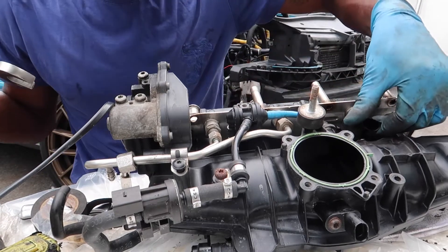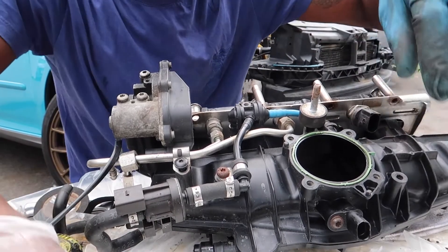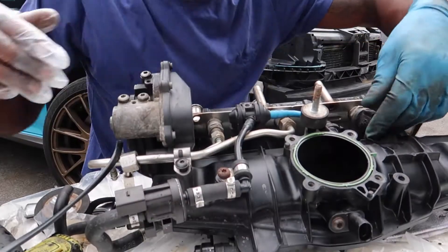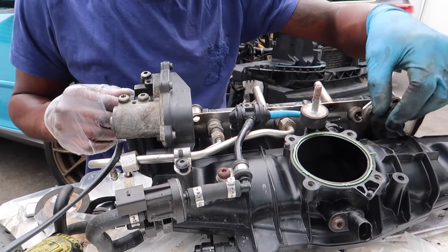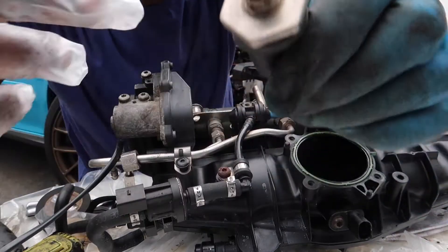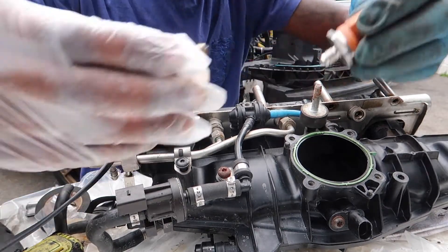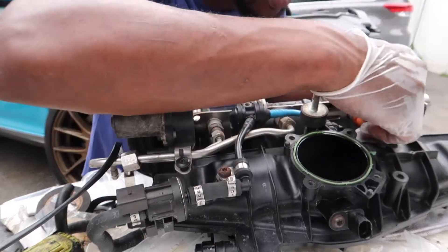So this sensor right here is the upgraded RS4 sensor. We're gonna go ahead and put the new one in — I already loosened it. You're gonna need a 1 and 1/8 wrench. That's standard — probably like a 27mm, kinda. Now look at this valve right here — this one is filthy. If you look on the inside, it's real filthy. So maybe this is what's causing our issue. They're probably gonna have a different part number because this one is a different revision.